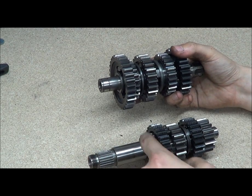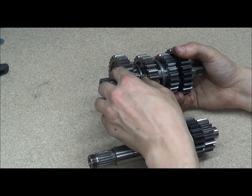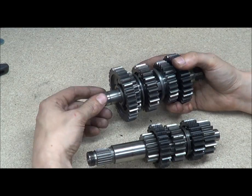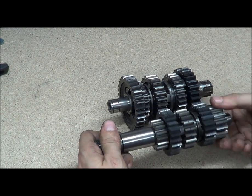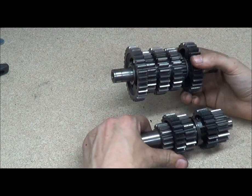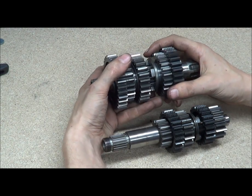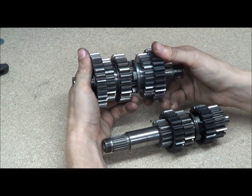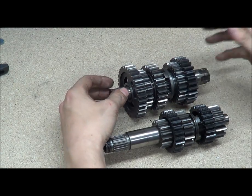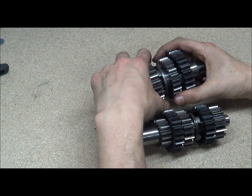So the power is going through these teeth — through this gear I've selected first, which is actually the fifth gear position. But because it locks into it, and because fifth gear is static to the shaft, the power is going through this gear and this gear, and it rotates at that speed. For second gear — second gear is a static gear again, so the whole thing spins. But when you get to the output of second gear, this is a freewheeling gear. So this selector comes across — the selector fork, your selector drum and selector forks, moves this gear across — and now the power transfers to this gear and turns the shaft.